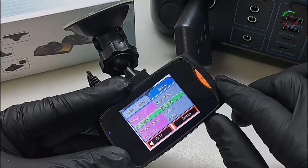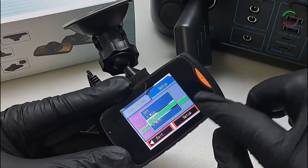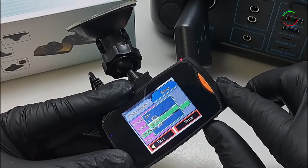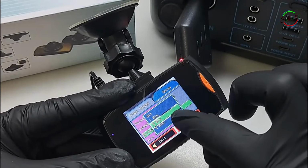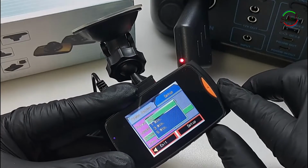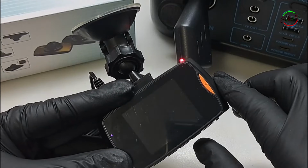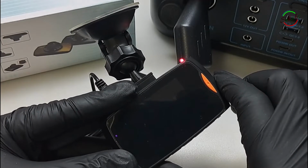Those are the basics. Look for screensaver, press the OK button to see the options, press the up key or down key to choose the specific time in minutes. There are 4 options: off, 1 minute, 3 minutes, and 5 minutes. Press the OK key to confirm the option. Press the menu key to exit the setting interface to finish.